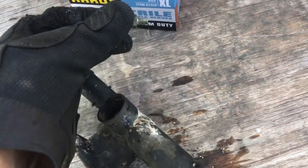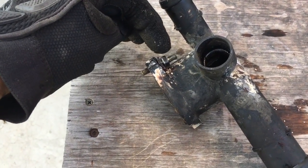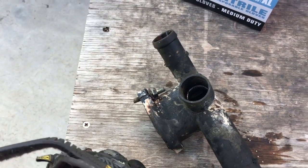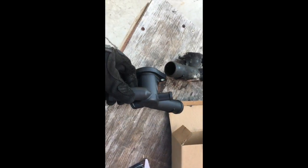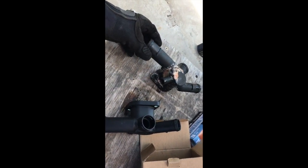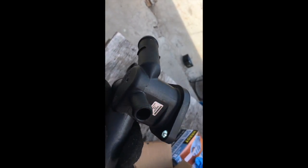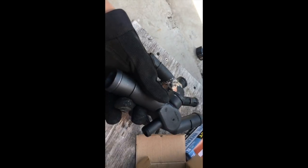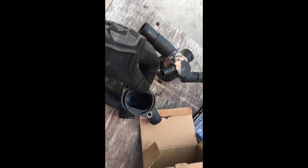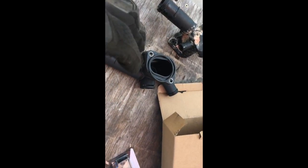Here's the bolt I was talking about — it has a stud that goes in there, then a bracket goes here, and then another 10-millimeter bolt goes on top of that. Now let's get to putting the new one on. This is the new flange — make sure you compare to confirm it's the same thing. It's not made in Germany, it's made in China, but it was only about 10 bucks and I'm sure it'll do fine. It comes with a new gasket. I am not going to put any sealant, even though that's what you see on YouTube — that's just my choice.